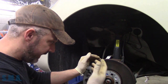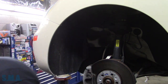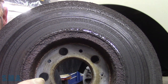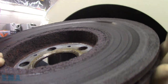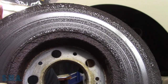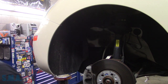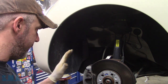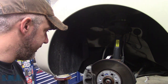Needs front brakes — it has lots of pads on it, but the insides of the rotors are super rusty. I did the other side already, so it wouldn't look like a rookie doing this side. And this is what the inside of the rotors look like: outside shiny, inside super rough, super pitted. The guy just selected to put some new rotors and pads on it directly from V-Dub, so we've got some genuine OEM parts installed on this baby. She's pretty clean, not too bad, low mileage — it just sits all the time.